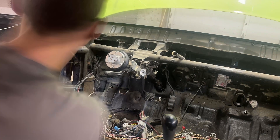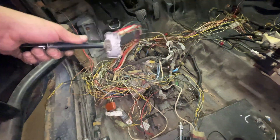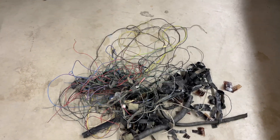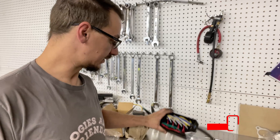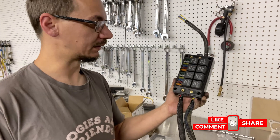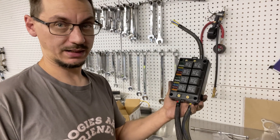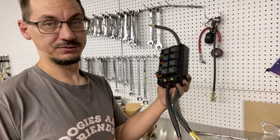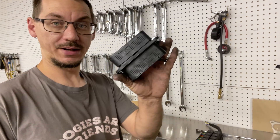The wiper and the whole column is gone now. I still have this one — the headlights — so I can keep them in one area, probably run them to switches, then this will be gone. Here's all the stuff I've taken out so far — some wire loom in the trash, and all the wires from that loom. I did say I might not use the relay fuse box, but thinking about it I'll probably use it because I need relays for the fan and for the headlights, so it'll be easier than trying to reuse factory stuff.